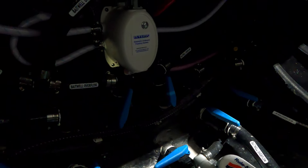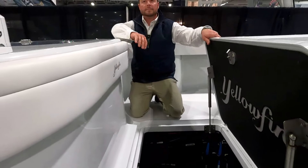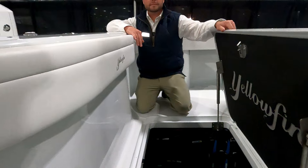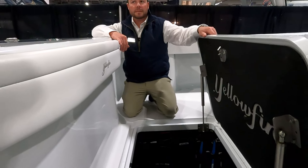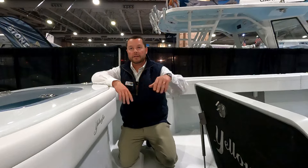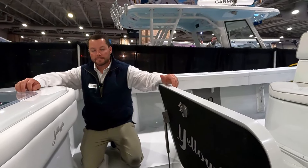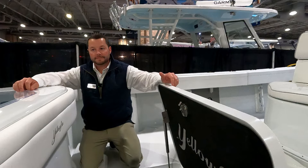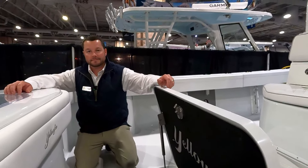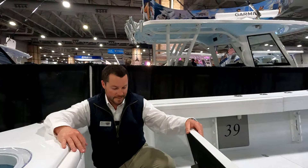There's a Reverso system down there as well. I made one for my boat — I plumbed hoses through the rigging tubes and tied it into the inside of the motors with a single hose hookup and a switch. With this Reverso it changes from each motor for you, especially in a three-motor situation. You might not have enough pressure otherwise — most docks won't. People talk about doing Y hoses but unless you're at your own private dock, you're not going to have the water pressure for that.